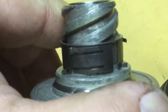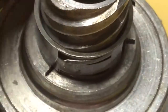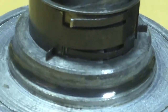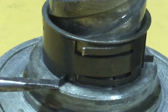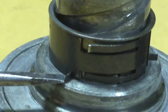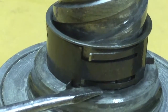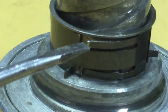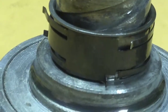There are a couple different elements to the sequencer I want to show you. There's the lockout tab which does the actual locking out of the high-speed clutch so that it cannot engage, so that you get low speed. There's the indexing spring which indexes in the notches in this sleeve here, and then there are the drive pawls which actually help to advance this forward each time.